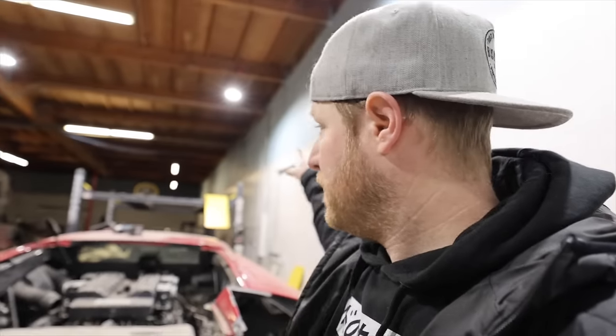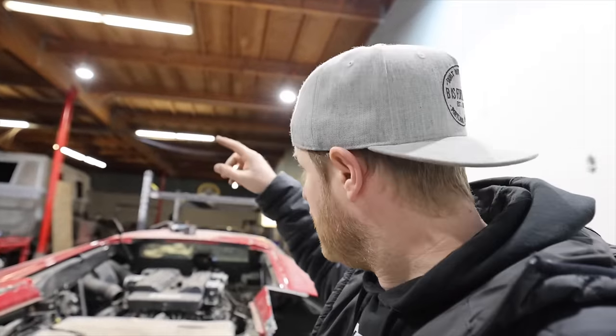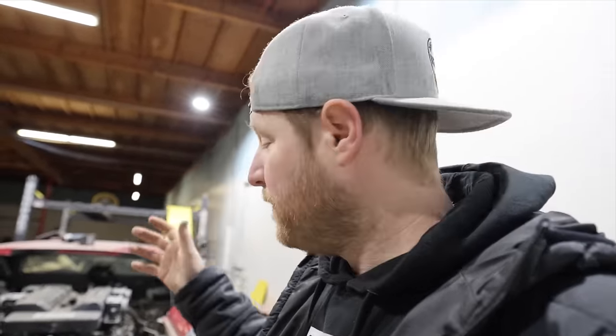So what we're gonna do is we're gonna get our gantry, that's that big, big arch looking thing. We're gonna bring that over the engine over here. We're gonna strap up to the engine, and we're gonna start taking the weight off of the car. And then we'll get underneath, undo all the bolts, and then we'll start trying to massage this engine around, engine and transmission and rear differential, and get them to move back into the spot where they belong.